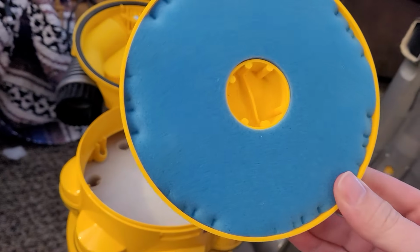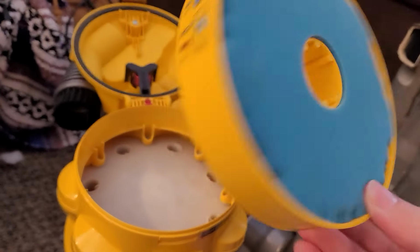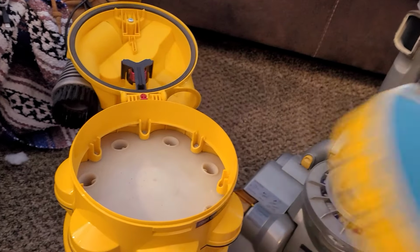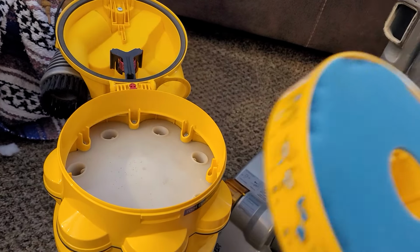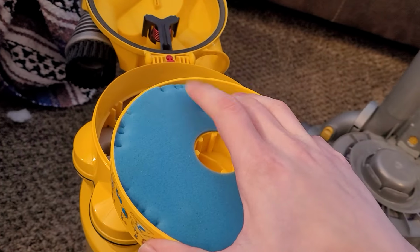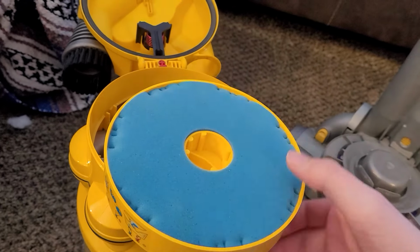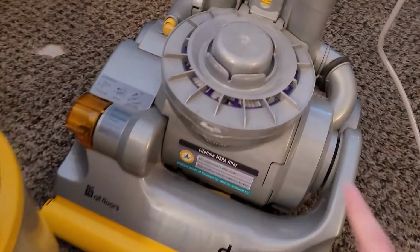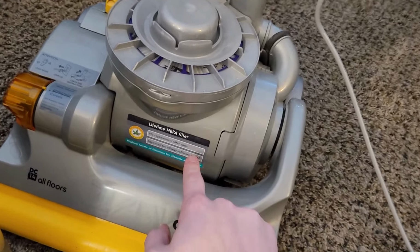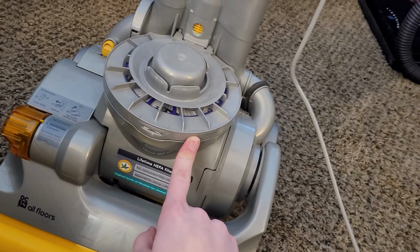Although the Cyclone separation isn't quite as good as the newest Dysons, like the DC41 and newer, as they all have the same cyclone pack, but it's very, very close. And obviously a lot of these filters are going to be deteriorated enough after being washed for so many years at this point, so you should probably replace them, in addition to the post-motor filter, which Dyson claims is a lifetime HEPA filter, but should be replaced about every 5 years.